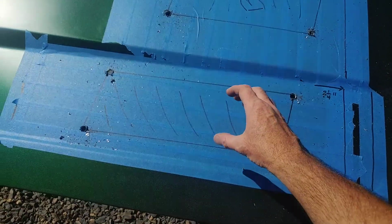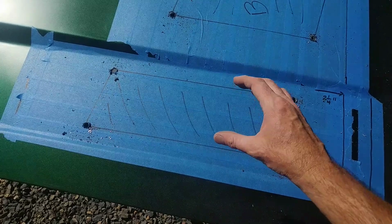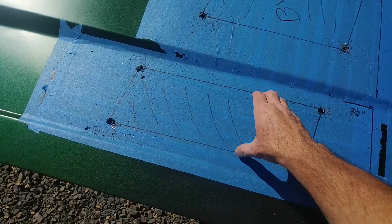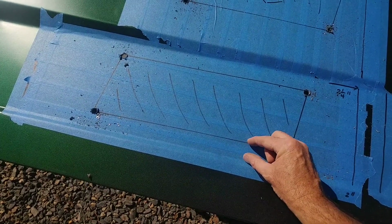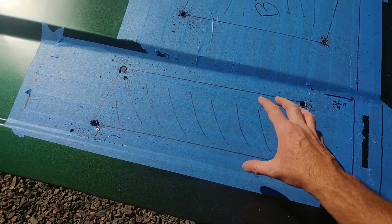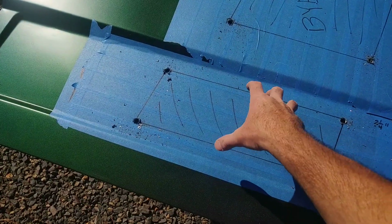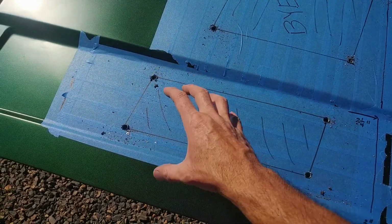Now it's better to have a slightly larger opening than needed than a slightly smaller one, because you still have to get the vent down in there. So going a little wider is fine. You have a little bit of an edge. Remember, you have an inch lip on the outside here, and that'll hide any of that opening. And having it open means you can actually move this around a little bit to make sure it's perfectly fit before you drill the mounting holes.